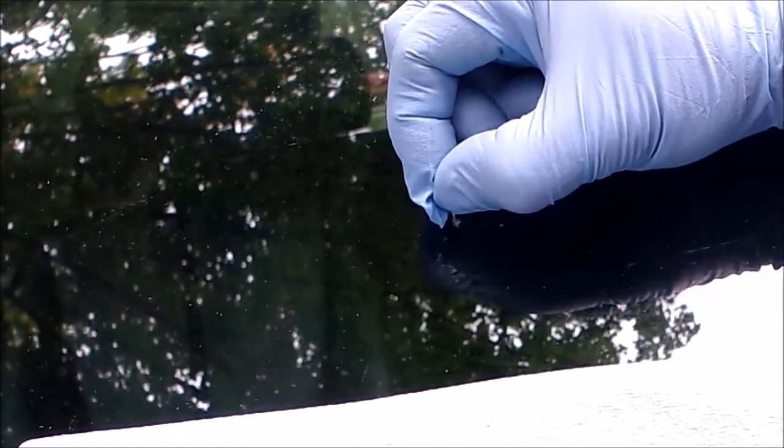Okay, so I'm going to take the razor blade, clean this off, any gunk left around the windshield. Pick out any of the old resin. They do send you a little pick for this. Might as well use it. It's just a little red, like a push pin. It's just to loosen any debris, any old glass and stuff that's inside there. Ugh, I hate this sound. Wipe it clean.